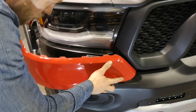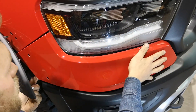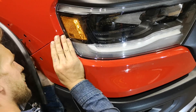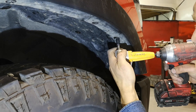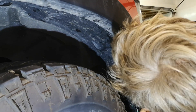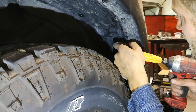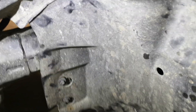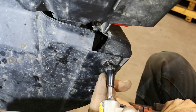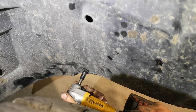Reinstall the lower headlight panels the same way they came off — starting with the grille side, press the two tabs in and work toward the fender. Reach inside the fender and reattach the lower panel with the 10mm hardware. Reinstall the fender flares by snapping them into place, then using the four 8mm fasteners reinstall the inner fender to the fender, tightening from back to front. Insert the lower inner fenders into the wheel well, sliding them over the factory hardware that was loosened earlier, and finish by reinstalling the remaining three fasteners with 8mm heads on both sides.